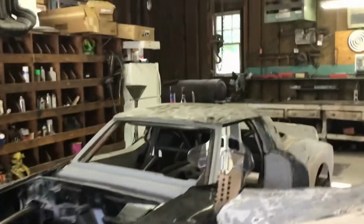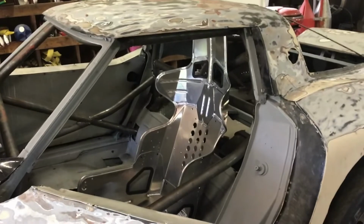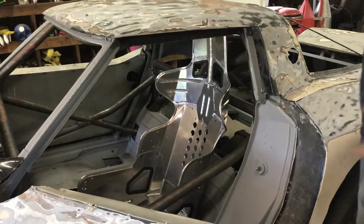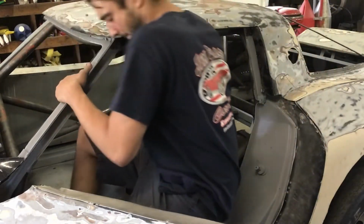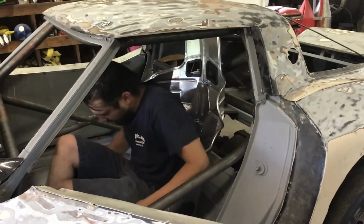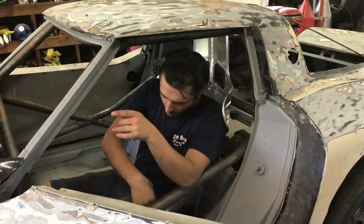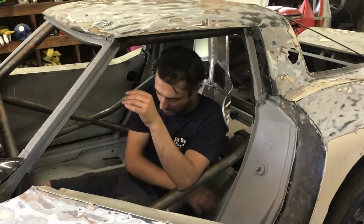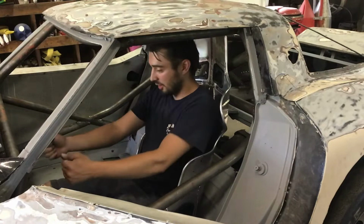I'm just messing around with this seat right now and trying to see where the best spot for it is. I got good reference with the other C3s, that number 13 car, and a couple other C3s at gyms that I'm using as a bit of templates. Let me show you. Right like this, I got good clearance this way. I got room to run my AccuSump line, my oil line, right here with a valve on it to open and close the AccuSump. So that's good.